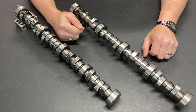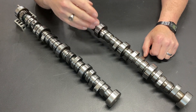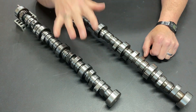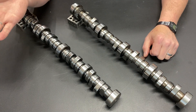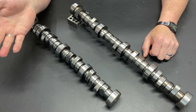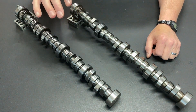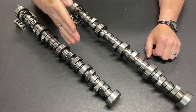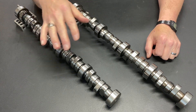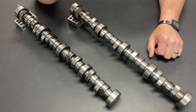There are a couple reasons for that. The first issue is RPMs and where that motor is designed to produce max torque and max horsepower. If you want to maximize torque and low-end grunt, you're going to sacrifice overall horsepower. If you're wanting to maximize overall horsepower, it's going to come at the cost of low-end torque. The second issue is all of these specs for a camshaft are interrelated — changing one spec affects how the others respond to the overall configuration of the motor. Those two things together are what make camshafts so confusing.